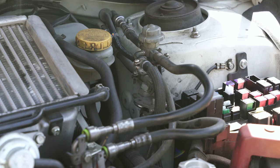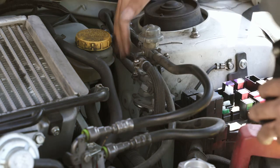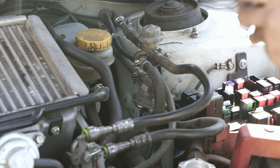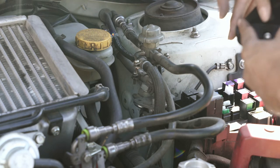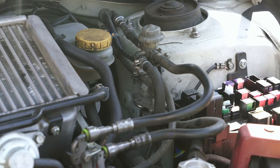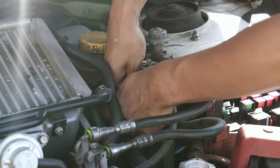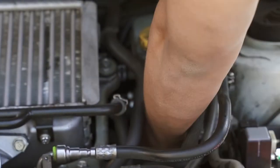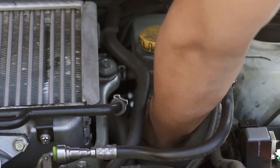My plan is to screw those three M6 bolts in loosely — one, two, and three right over here. There are like five holes there, but just use common sense; it's the ones that are kind of next to each other. The brake cylinder brace is technically on now, just missing this last bolt here, and that one is going to come right through over here.